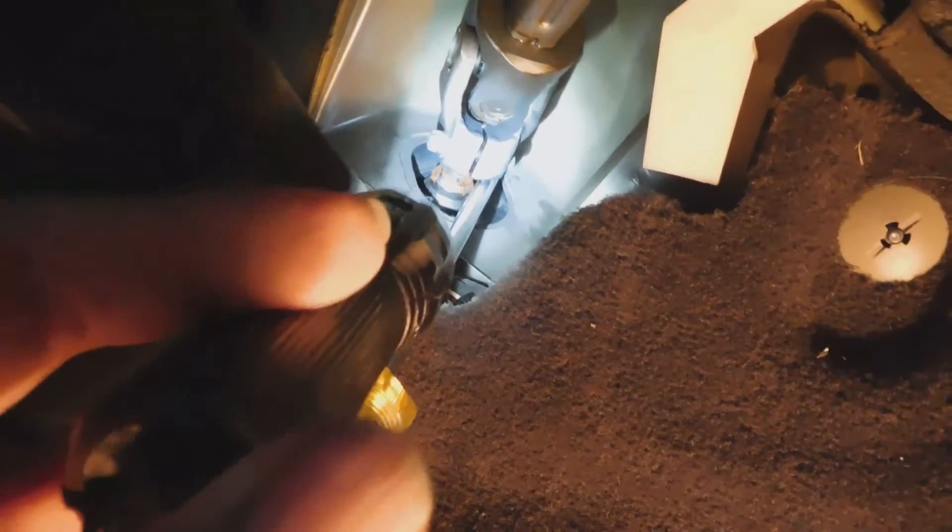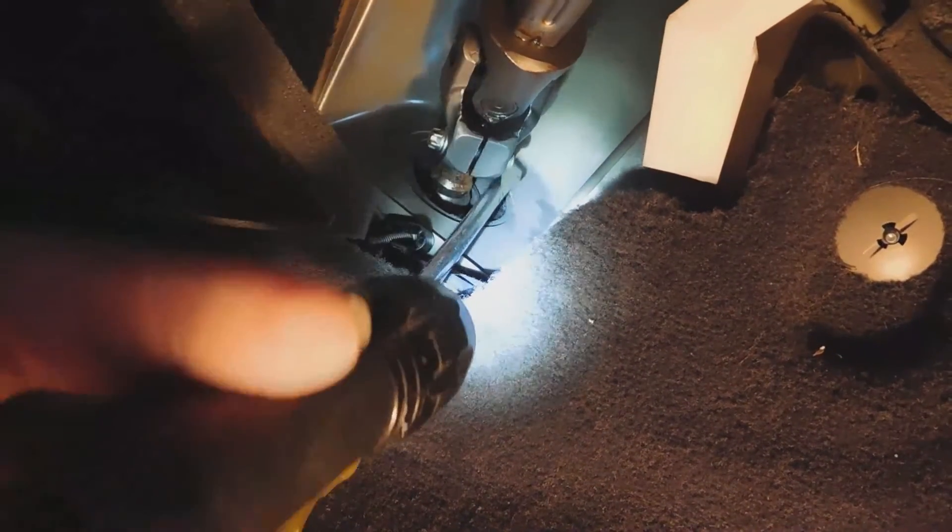Your keys, your gloves, your pockets, your everything. You can see that pinion just lifting slightly when I leave it underneath there — that's the rubber mounting of the actual rack. So when the wheels strike things and bumps, the rack can move a little bit on its rubber mount, and that movement has to be facilitated by that sliding cloverleaf. It can't be dead tight, and that's the problem — these binds.